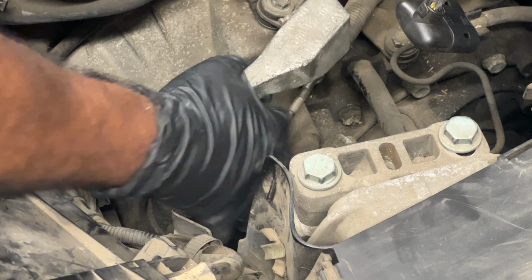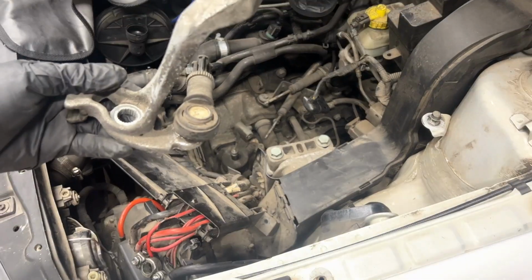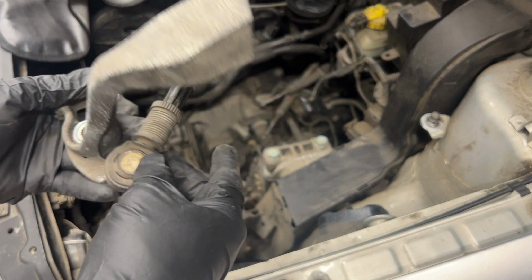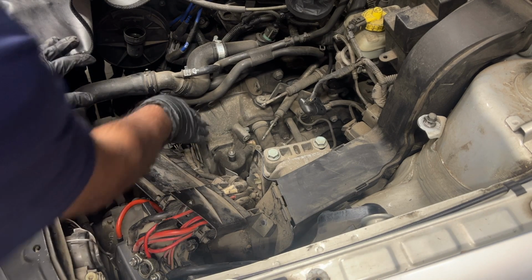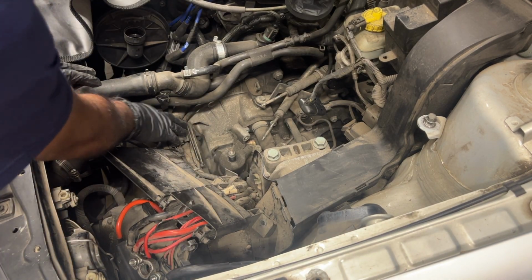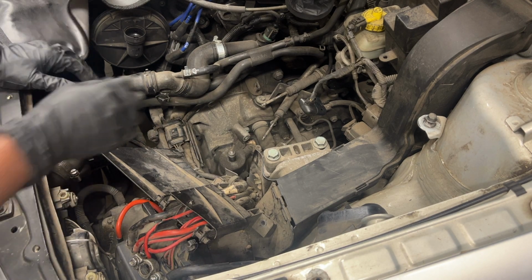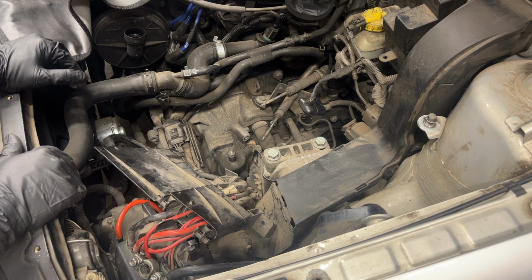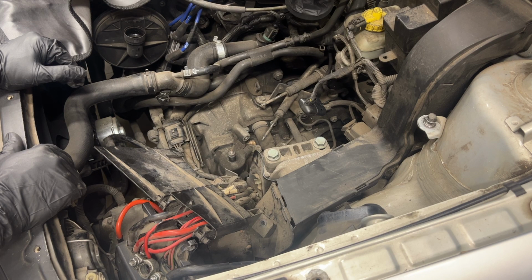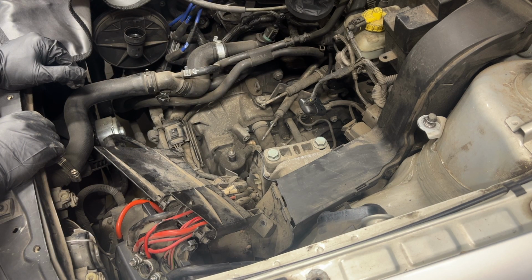Now the whole unit should come off. There we go. Let's go back here. That's the balancer. Put them all together. Okay, now that is done, I have access to take the bracket off that holds this harness, and right below that is the starter, followed by the bracket here that holds these cables. And then I can take the bracket off and tuck it away from the transmission.